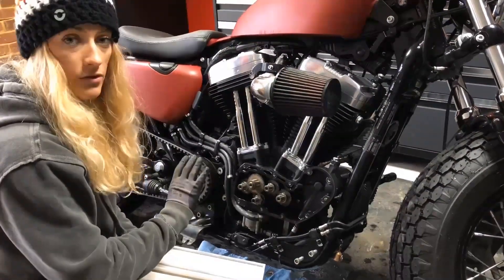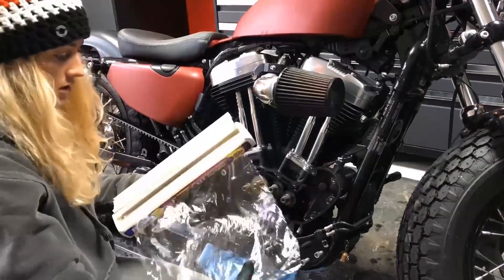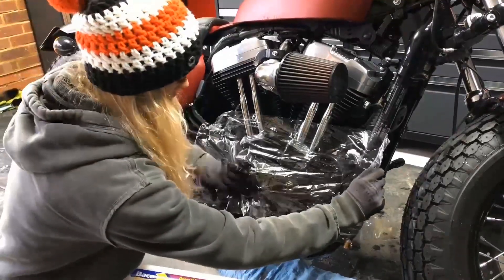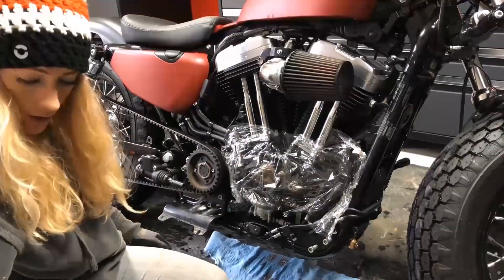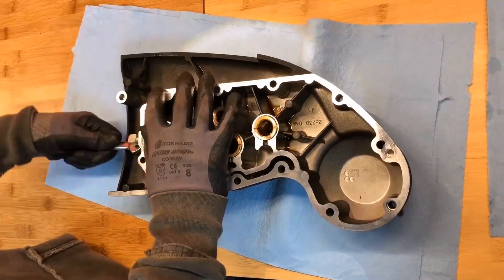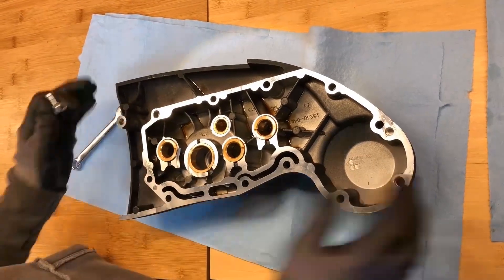While we're working on the bike I want to make sure that there's no opportunity for any dust or dirt to get into the gearing system and the engine. So I've got some standard cling film from the kitchen and I'm just going to put it over the top to make sure nothing can get in there while we're working. Now it's time to get cracking — I've got a 7/16th spanner to remove the oil pipe union; you don't want that getting in the way with the angle grinder.